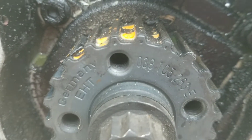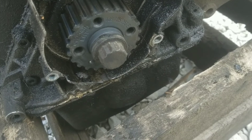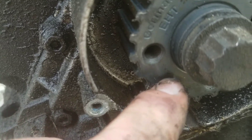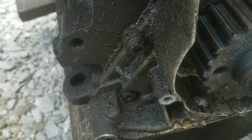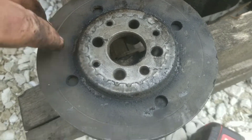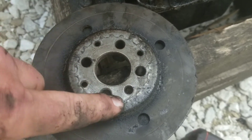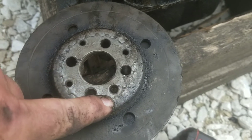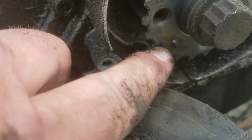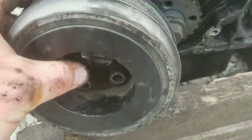There's your little third dot to the left, lined up with that guy. The other thing I'm going to say — it should be self-evident when you put that crank pulley back on — but there's a little protrusion, a little dimple that lines up with the biggest hole that a bolt doesn't go through on the back of your pulley. The other holes are pretty small, but it lines up with this bigger one. So you're going to line this bigger hole that a bolt doesn't go through with that little dimple — that's how you get this lined up correctly.